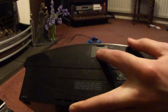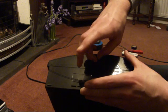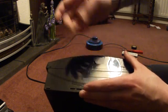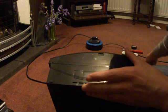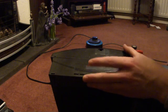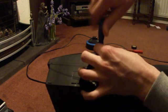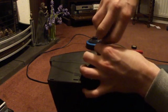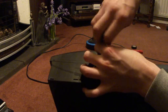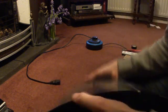This one hasn't got the warranty sticker because I've taken it apart already and stuck a bit of black tape over it. So you peel off the warranty sticker, or in this case the black tape, take off the rubber foot on the bottom, and that gives you access to a torx screw. Undo that torx screw and take it out.